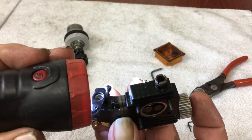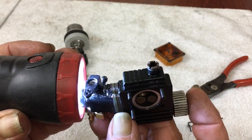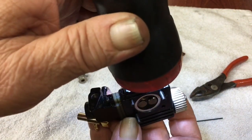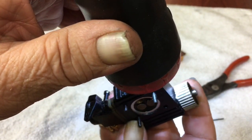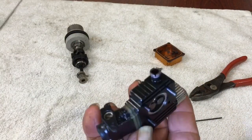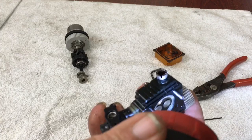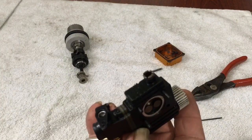I'm gonna try to get some light over here to show you — the intake valve is actually open also. So I've heard a lot of people say these things don't have a lot of compression and I don't know why. But if you look inside there, you'll see it is clearly not sealing up — see the gap in there on the exhaust and the intake at top dead center.